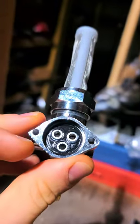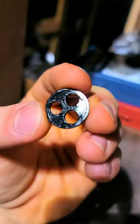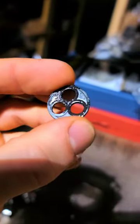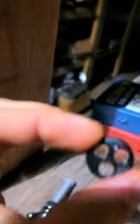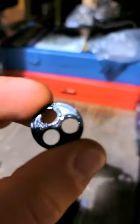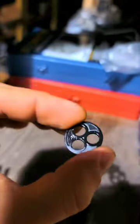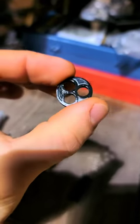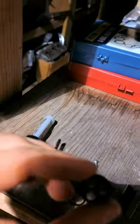I'm going to pop this O-ring out and see if the other side is okay, and we can just flip it around. Now that I've got this front seal out, you can see the middle of it has ever so slightly ripped. Between the two hoops on the right side here you can see a line going right through it. But on the back side it's perfect, so I'm going to flip this seal around and install it right back in. If you pull this ring off and both sides are ripped, you'll probably have to order a whole new petcock, or see if you can find a replacement rebuild kit online.